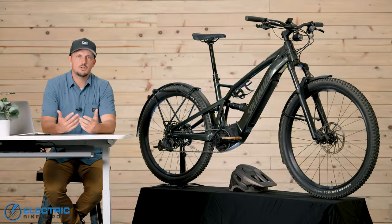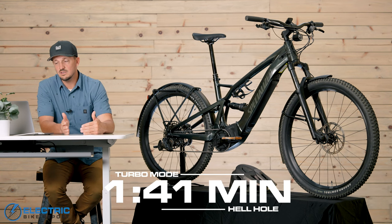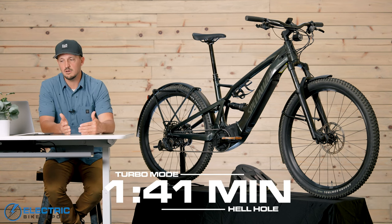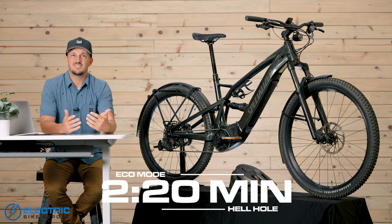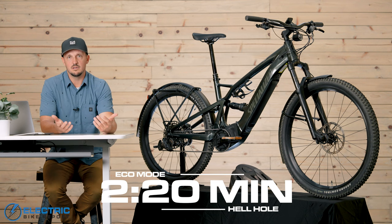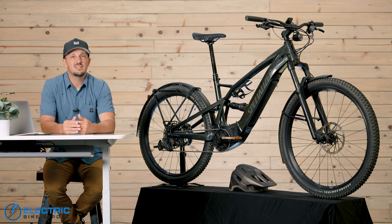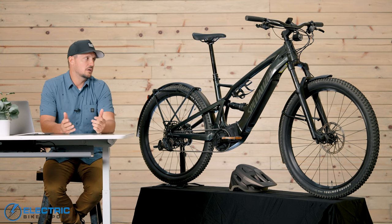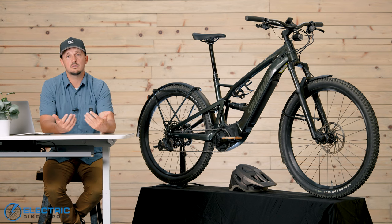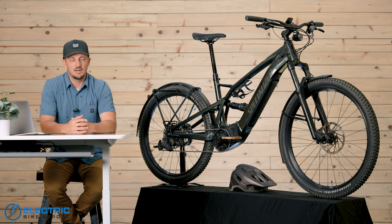The Turbo Taro X did really well. On Turbo it climbed in 1 minute 41 seconds at an average of 10.7 miles per hour. On Eco it took 140 seconds at an average speed of 7.7 miles per hour. That's a steep hill — an average 12% grade, a third of a mile long, and pretty taxing. But if you need to climb hills, this is going to do a good job. You're still going to have to put in some power — it is three times you — but you can take it pretty casually in Turbo and climb almost the steepest hill you'll find.